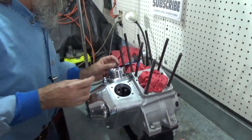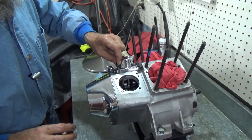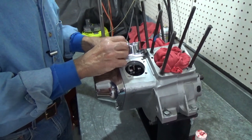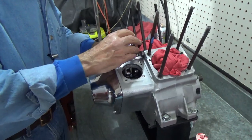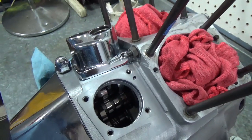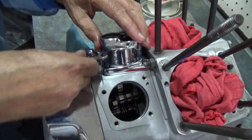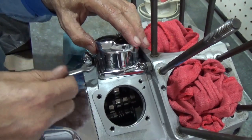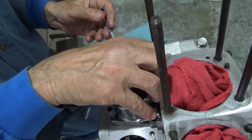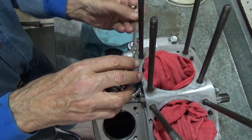They make an alignment tool, and most people use one — that's what they show. I use two, because that really lines it up real well, and I just happen to have two so why not? So there we go — lifter block is now in place, and we know that it's located well. I don't think I brought a flashlight out here. But if I did, you could see that those rollers are lined up real well. There's my flashlight — it shows how well the lifters are lined up on the cam.